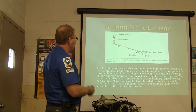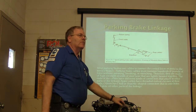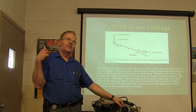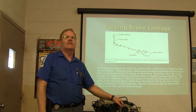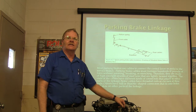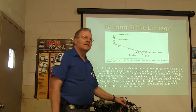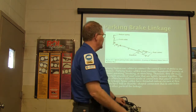All right, you got some linkage here, you got a return spring, you got these cables here, you got equalizer. We had one time that was a 94 Ranger, I guess it had been driven through River Creek in the county, and when we got it in here doing the brakes, all of the springs in the rear were rusty, all of the park brake cables were rusty, everything in there was rusty. First time somebody applied the park brakes after we rebuilt the rear brakes, they wouldn't unapply. So we had to replace all that stuff. And the park brake cables don't usually cost all that much, but it's really aggravating whenever you gotta go in there and do something to get them to release whenever they're hung up.